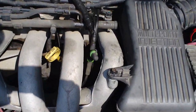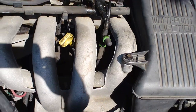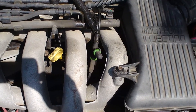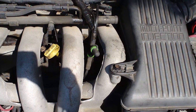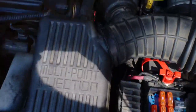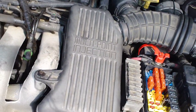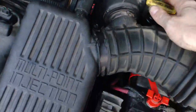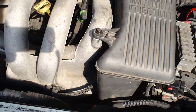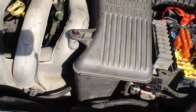It's not that bad to swap out. The hardest part is that bolt on the bottom. If I had to do it over again, I would find out the size and pitch of that bottom bolt and replace it with a stud and nut — that would make it way easier. The top one's no problem to get to. You do have to take some stuff out of the way; I went ahead and pulled the transmission dipstick out to make it easier.